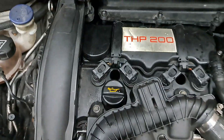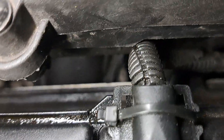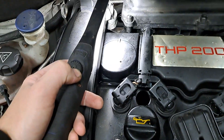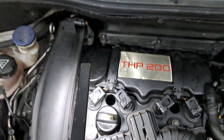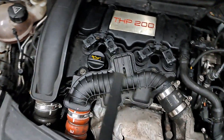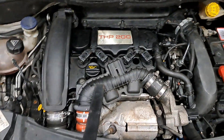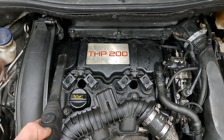What I actually found is this rocker cover is actually broken — you can't really see it. But if I take a torch and stick it down the back of the engine, you can see the oil along there. Right there, there was smoke coming out. And if you actually start the engine and put your thumb over the crankcase breather, you can actually hear it sucking air from around the PCV valve just there. That means the rocker cover is damaged. So we need to replace the rocker cover, and then hopefully that'll stop the intake reading the extra air that this is sucking in unbeknownst to the air mass meter.